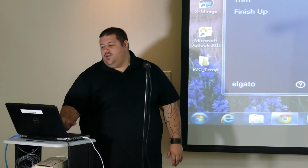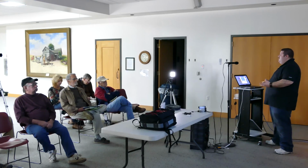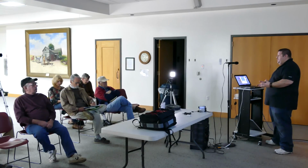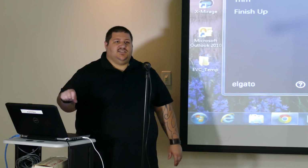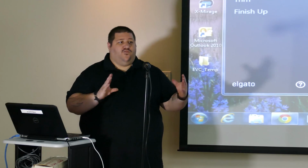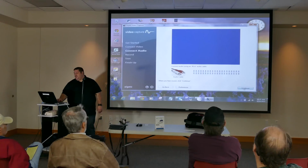At this point, you're going to select whether it's a 4x3 or a 16x9. Chances are, if it's from VHS, you're going to be in the 4x3 format. That was the standard format for your older TVs, a lot of your older camcorders, all that stuff. If you've got a slightly newer one, there is the possibility that if it's a mini DVD or a mini DV, you could be in a 16 by 9 format. It's good to play that back in your device first to know which setting you're going to want. The difference between a 4x3 and a 16 by 9, one is a square, one is a rectangle. So your 16 by 9 is going to be more like your HD. It's going to be more of a rectangle. So we'll go ahead and hit continue.